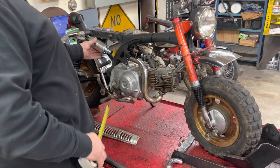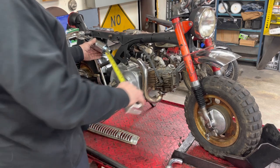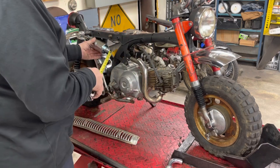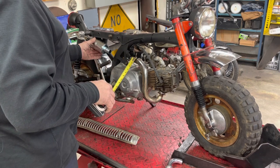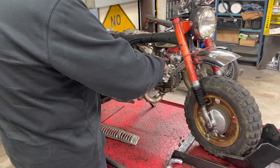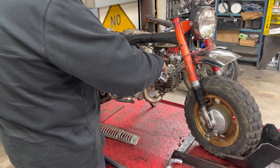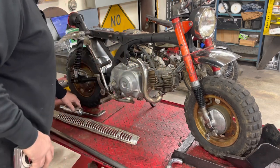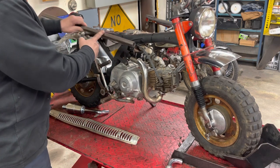Okay, so what do we want? Maybe stick out about like that? Yeah, that looks pretty good. My tube and this are about the same diameter, so I'm gonna have to butt weld it there, but my tube will slip over top of this. So I'm going to have, you know, a half inch of play or something. So if I go 7 inches, that should be plenty. All right, so we're going to go take this tube and chop off a 7-inch piece